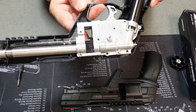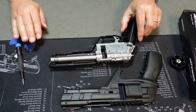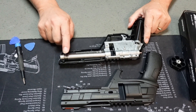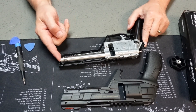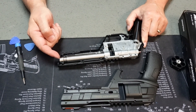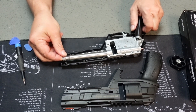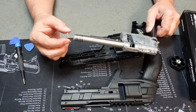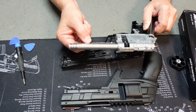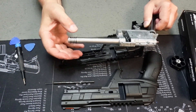We're going to pause here for just a second, guys. Anybody want to take a guess what that looks like? Now, to remove this mechanism — this has something the TR-50 and HDR-68 do not have: on top of the spring that controls the barrel going in and out, which holds tension on the drum, you've actually got a metal washer that fits on the spring behind that little plastic holder. That's pretty cool. Occasionally when you put these back in that will bind up, so be careful. Now we'll pull everything out together — easy on this one. And here's the barrel — we're going to slide it out.